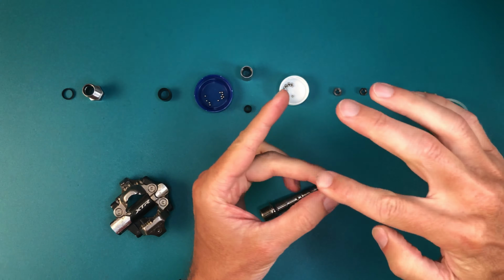With that set, hold the cone with one wrench and tighten the lock nut down with the other. Don't forget the reverse threads. Once it's set, check for play or tightness again. It's not unusual to go through this adjustment three or more times before getting it dialed in right. Once you're there, make sure the lock nut is good and snug, and check the play again.